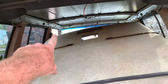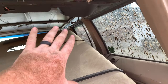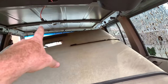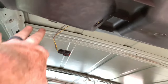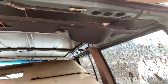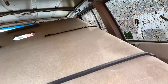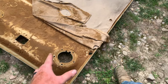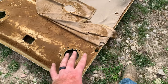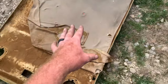A lot of people take these off right here but you don't have to — you can pry it out a little bit and this thing will drop. If you can get the drop on one side you're good. It's out now. Unplugged everything, the dome lights are out — you gotta take those out. Take your speakers out, there's a Torx bit. Leave your speaker bar hanging up there — it just kind of hangs there. Here's how bad it really is; I'm gonna take a hard bristle brush and just scoop all this off the fiberglass and peel all this back.